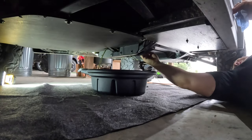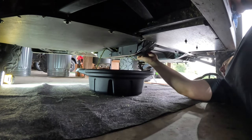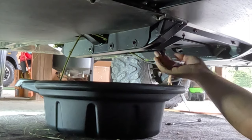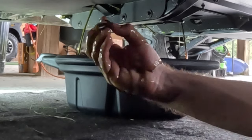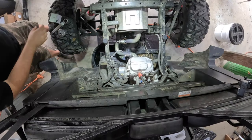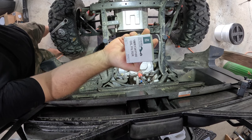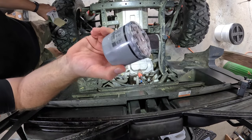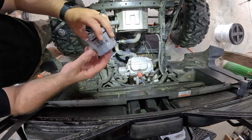Here's the problem with being a bigger guy — you get under these machines, it's not a lot of fun. This is probably the world's longest oil drain plug. There's a crush washer on here — just want to be sure you don't lose that. Crush washer and drain plug. Not magnetic, but we're going to take a look at what this oil looks like. In checking this part number: 1MR1341100 oil filter. Very simple. I'm going to get a marker and write the date on here that I'm doing this. Since this is gray, a Sharpie will do. Today is September.